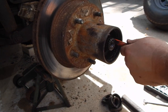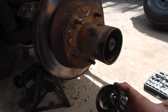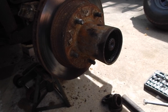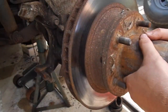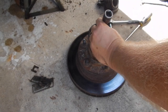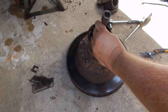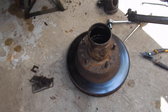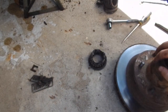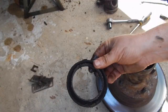Right here is your outer wheel bearing. We're going to clean it up — you can clean it in diesel fuel or gasoline, inspect it, repack it — and your whole hub assembly should come right off. I'm just going to slightly tap it from side to side, barely tap it, and you'll hear it hit the ground. Am I damaging the bearing by doing that? No — I'm barely tapping it. And there it is, and here's your seal — no damage to it.